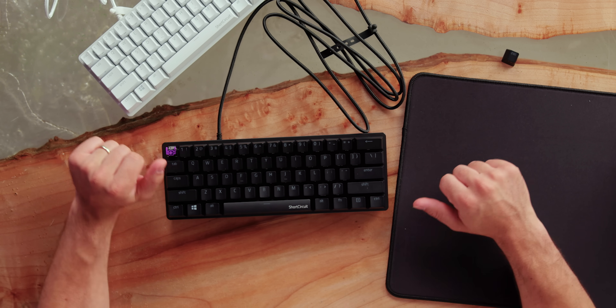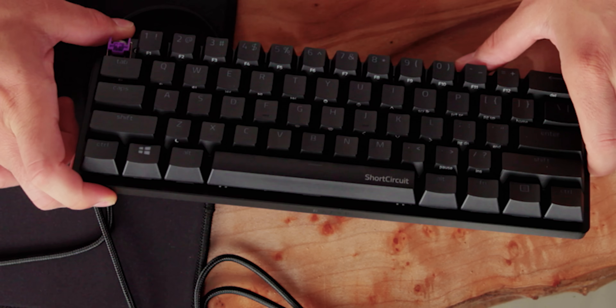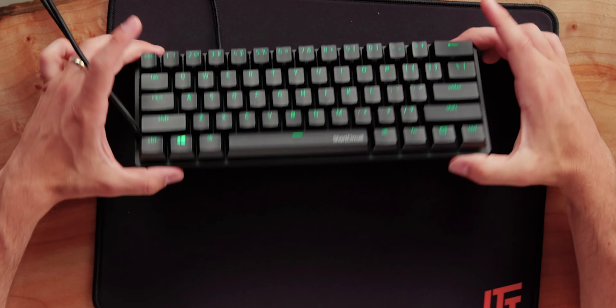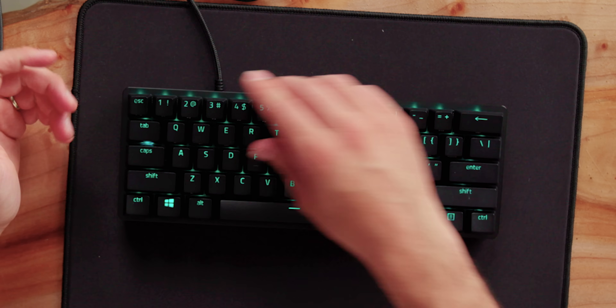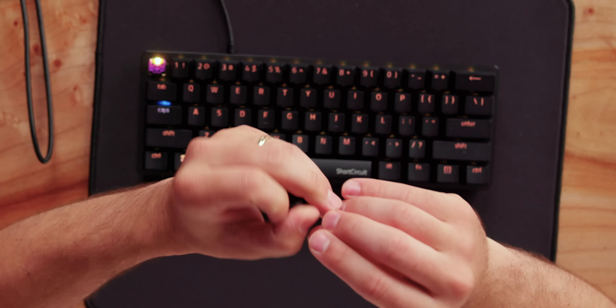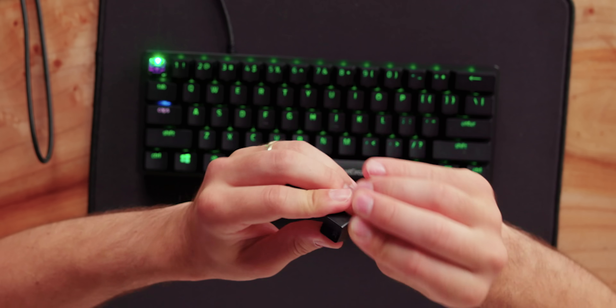Productivity-wise, it sucks not having a numpad, and it sucks using second functions. But Razer says you lose no functionality because all the second functions are available on a secondary layer — you can see where they are by looking at the side-printed legends on the keys. I want to plug this in to see if the light shines through there. It looks like the side-printed legend is just printed on there; I don't think I've ever seen secondary functions be lit up. The light is shining through the main keys because these are double-shot injected — the black area is one layer of plastic with a hole for the letters, and there's a second white layer underneath, so you can never scratch the legends off. These are also PBT plastic, so they're not going to get shiny. You know when you use a keyboard for a long time and you get that shiny look on the most commonly used keys? That's not going to happen with these.